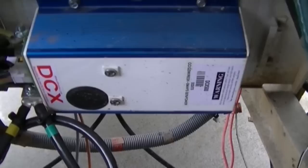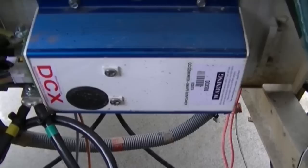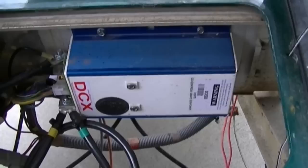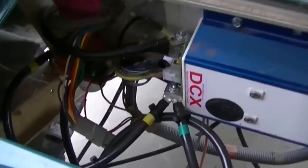All right, I'm going to show you a couple things about this cart. That's the Alltrax DCX500 Electronic Speed Controller. That thing is programmable — you can make the cart act a lot differently with that controller on it. That controller made the original motor a lot faster until it melted down, which wasn't really part of the plan, but I was going to replace it anyway.